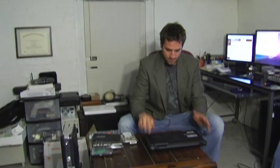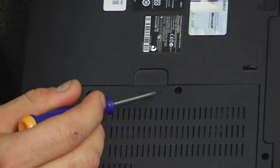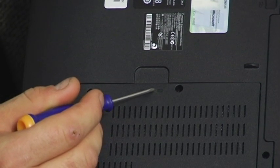Hi, I'm Gary Malek and in this video I'm going to show you how to put RAM in a laptop. Generally all laptops are the same in the sense that you're going to want to flip it upside down and look for the panel. As you can see here on the bottom there's a little icon for RAM here — it will be on any laptop, they all have them.